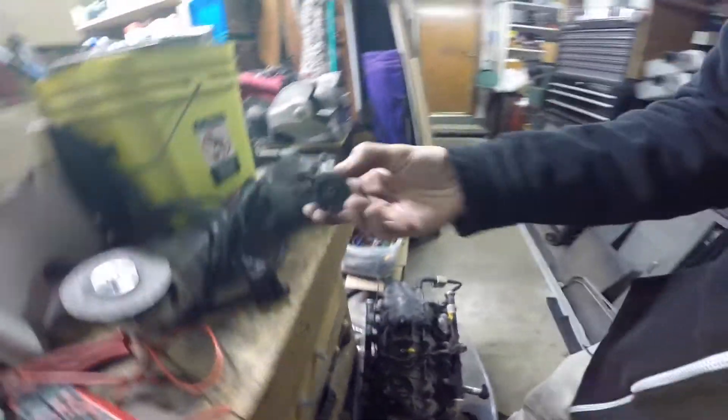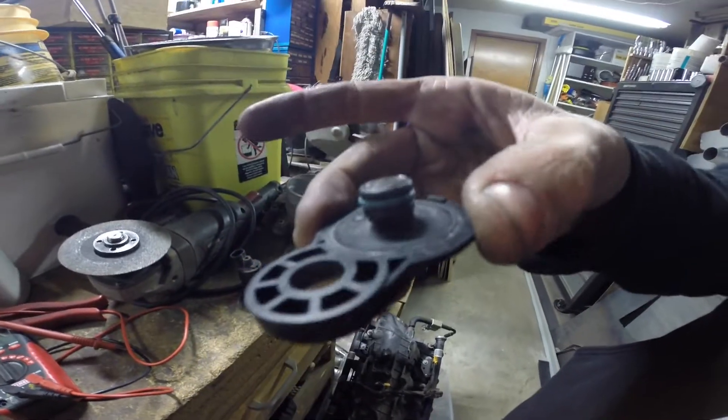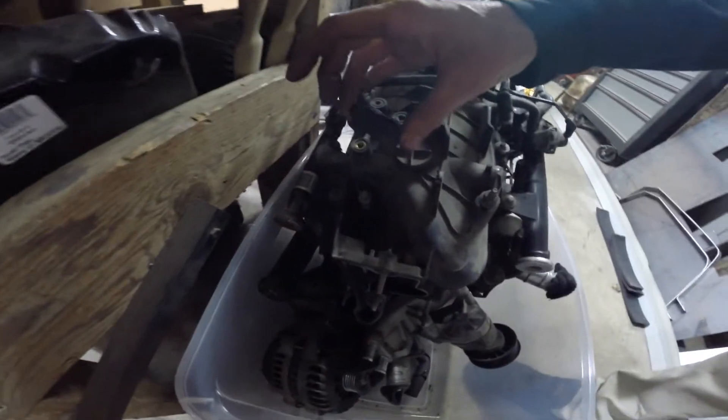I didn't have anything to plug that hole, so I just cut the bottom of it off, filled the hole, used my soldering iron to close it, and then filled the back with RTV. I'm just going to bolt that down right where it originally was, and that will seal up that hole — it's got an O-ring on it.